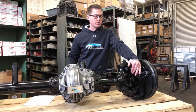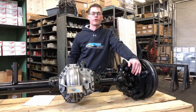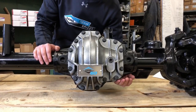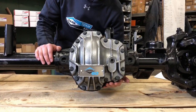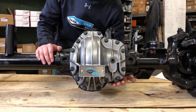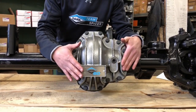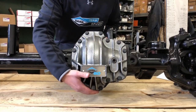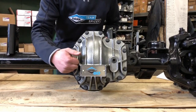1550 series u-joints should also allow you to get a higher degree of steering angle over a 1480 series u-joint. The new center section has been slimmed down as much as possible, giving you great ground clearance with this new design. Included with the new center section is a new designed diff cover — this is a nodular iron front heavy duty ribbed differential cover.